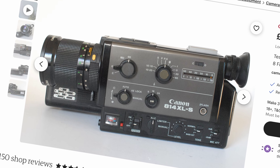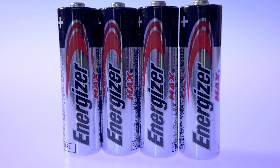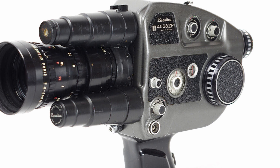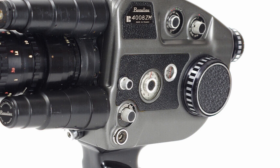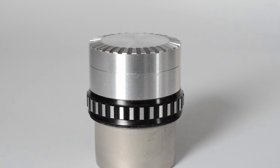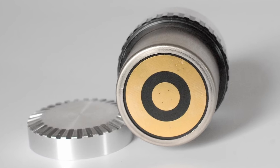The first is how the camera is powered. A large percentage of Super 8 cameras are powered by AA batteries, which makes them extremely convenient. On the other hand, there are cameras such as the Beaulieu 4008 ZM2, which was originally powered by a small NICAD battery. The original cells will be in poor condition now, so it's essential to check that the camera has been re-celled, preferably with a brand new modern nickel metal hydride cell.